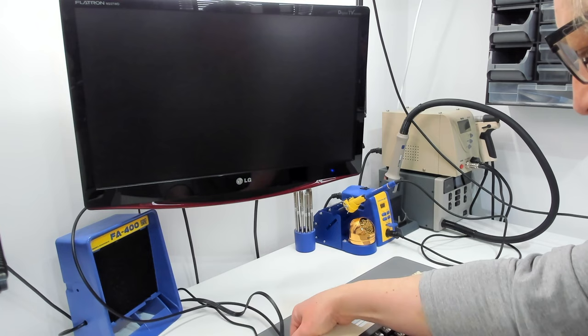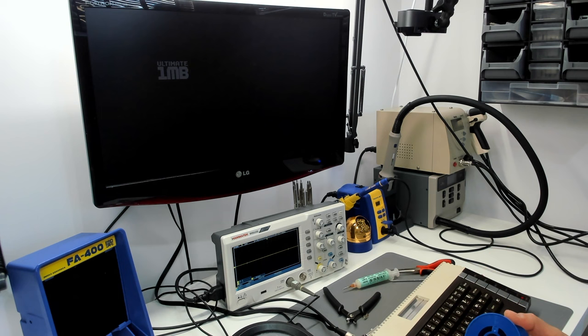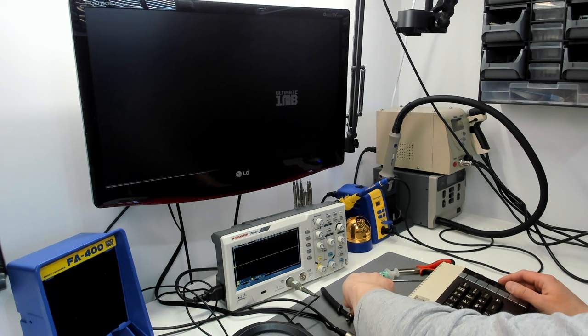The picture is green — isn't that typical. I've obviously nudged something when I was messing around with it. So I'm going to have to take the back off again and adjust the color pot. Adjusting the color pot is giving us blue. I still think that picture looks a bit dark for some reason. You join me after I've done some more work on this machine — I wasn't happy with the video at all; it wasn't just the lighting that was making the thing look dark on the screen.